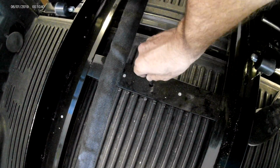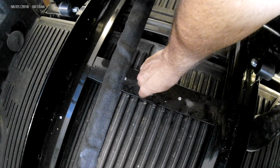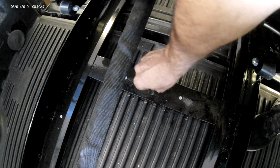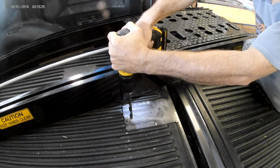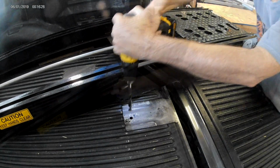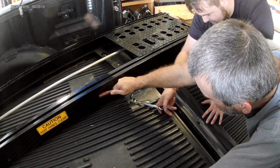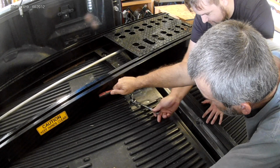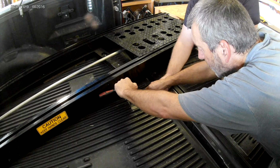Now here you can release the clutch on the winch again, and you can pull that ramp all the way back if you want, and that'll give you access to that rear hole. Mark that spot, then take out the front fasteners and move the unit off to the side, and that'll give you the room that you need to install the rear Plusnut just like you did the others.